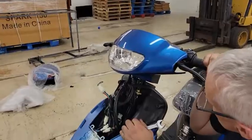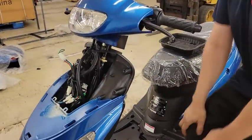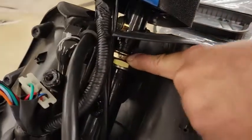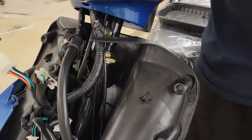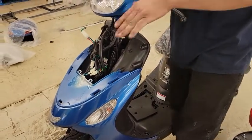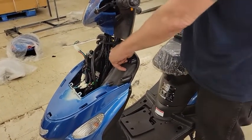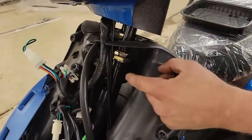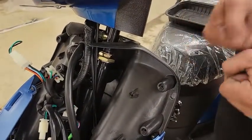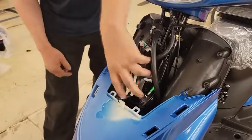I'm going to spin it back while pushing against it to get front pressure to hold it on, then spin this up with the longer ratchet so that it's fully tight — these have a tendency to loosen up if not completely tight. I've got a fresh charge on this so I'm fairly confident it won't have to be tightened much. I'm also going to check something the factory assembled: there are a couple of nuts here that change the tension of the bearings. If it's loose, the whole thing will move back and forth. If you need to tighten it, take the top nut loose, spin the bottom one further down until it's snug, then tighten the top one on top of it to lock them up against each other so they don't move.